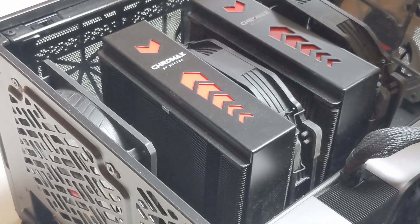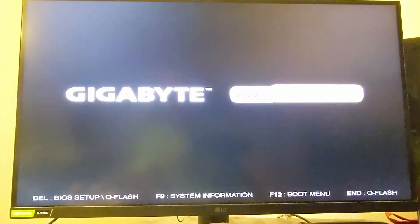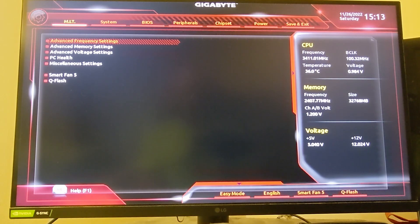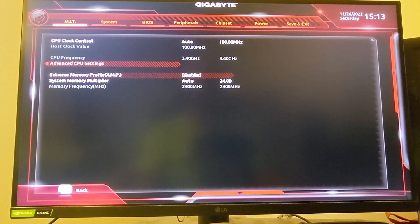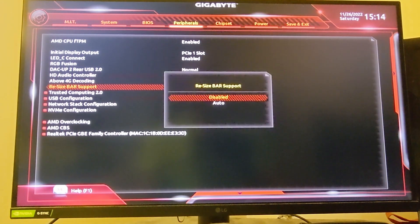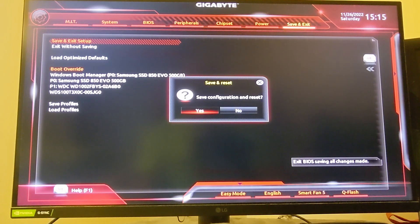With that, we're good to go. Firing this PC up, we do see a warning that it detects a new processor — that's exactly what we want to see. We say yes, jump on in, and it lets us know that the BIOS has been reset, so everything is good to go. We just need to make sure a couple of settings are correct. First, go to the advanced frequency settings and make sure that XMP is enabled — this ensures our RAM is not running at the default 2400 MHz and is actually going at the full 3200 MHz. Next, I enable above 4G decoding, which is for some virtualization I do, and resizable bar support, which helps boost your performance just a little bit. With that, save and exit and get right into the computer.